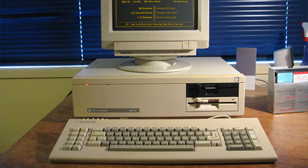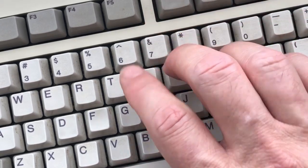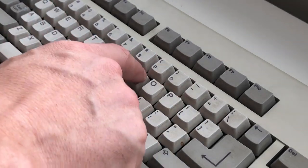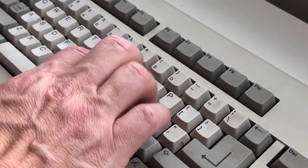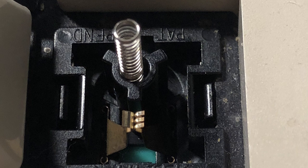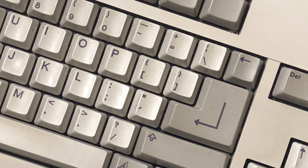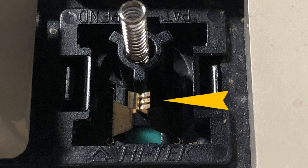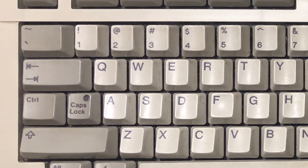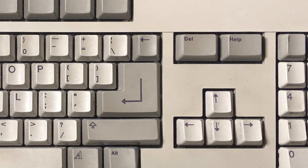The ones in the Amiga 2000 keyboards are known as white linear. This same switch can be found in some very early and quite rare Amiga 500, Commodore PC5, and PC10 keyboards. The space invaders feel a bit stiff while typing, which is actually kind of nice, and they're extremely stable — there's virtually zero wiggle in these keys. Compared to the Cherry MX switches, the Cherries are practically break dancing. If there's anything to criticize, it would be their fragility: take the keycaps off and there's a good chance the spring will go flying. The little metal contact hands are also very fragile — these keyboards were not made to be maintained or cleaned except by keyboard experts. They look great and feel great, but if you dare take off their clothes, be prepared for some shock and some pain.